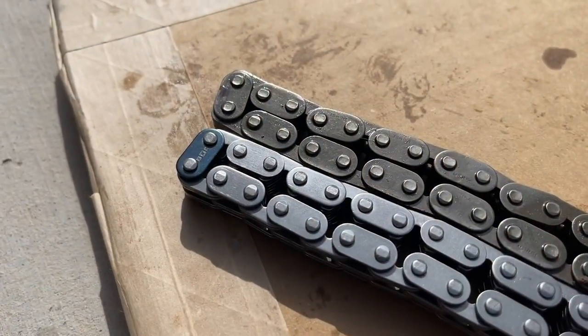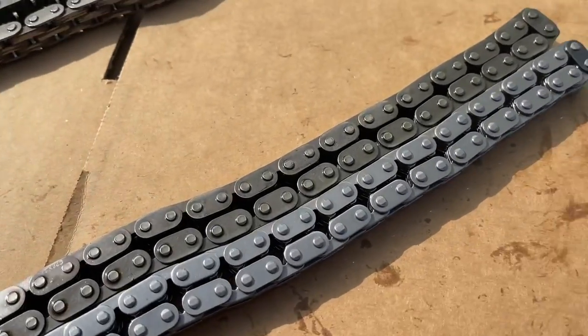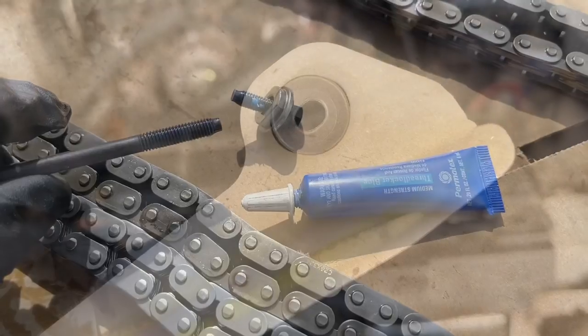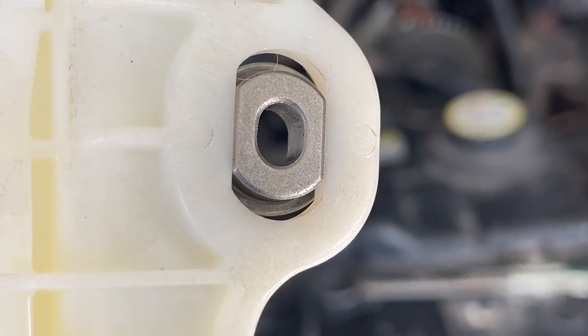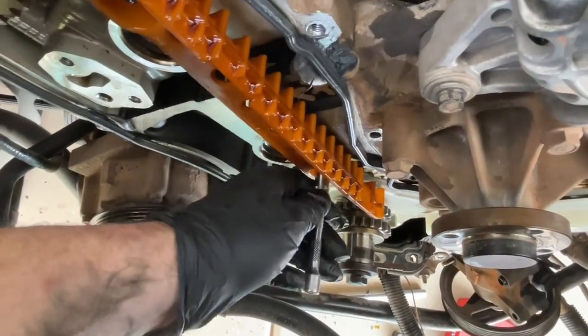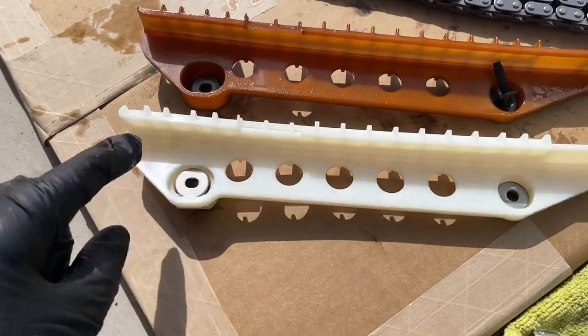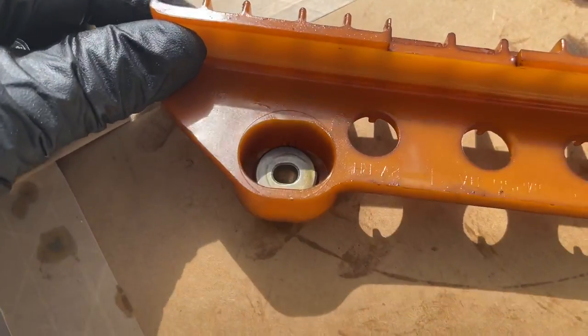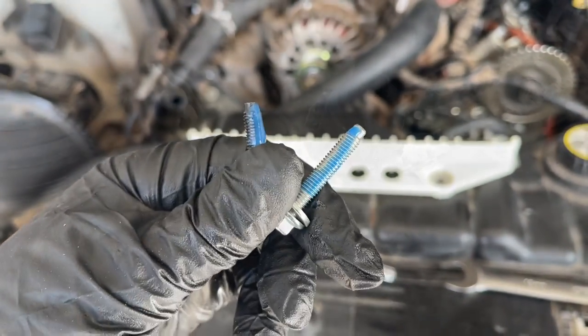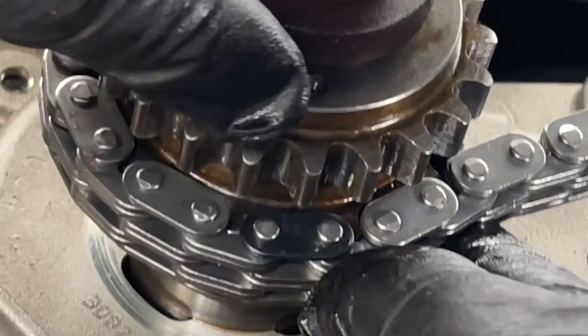Here's our new one - we're putting them side by side. And here's our new chain, putting it side by side next to the old one to make sure it has the same amount of links, just in case there was an error or it's the wrong chain. I then cleaned the threads really well and put some Loctite on them. Pay attention to these - some of them come loose and aren't popped down into place, so just work it until those are in place. Moving to the passenger side: same thing, two 8mm bolts holding these in. You will need a longer bolt with a lot of these new ones - see how this one is not recessed down in and that one is recessed? So you need a longer bolt. I'll put a part number for that in the description - I got it at Ford. We put some Loctite on those, dried all the oil off of them, and made sure that our link was lining back up as we put this back on to the driver's side.